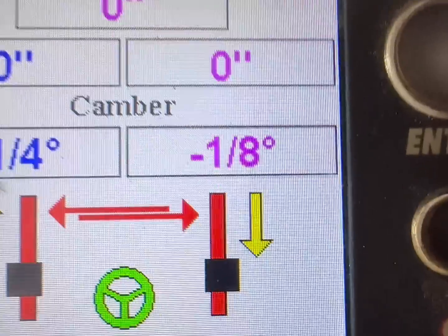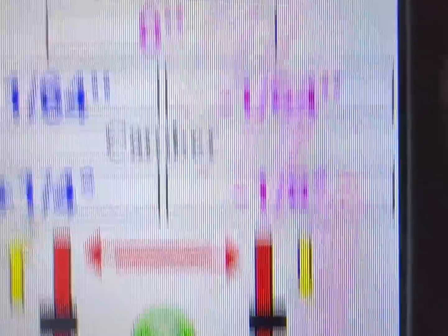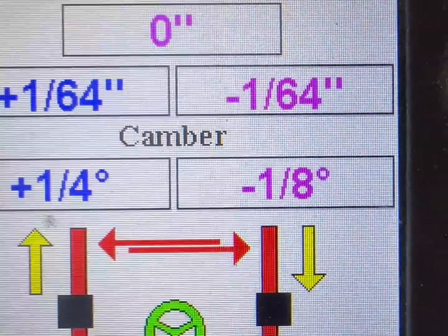This is one of the only ways to actually adjust camber on a semi. Most of the time people don't normally do that — you usually set the toe, do a little castor work, and let it go. But if you want to get maximum life out of your tires, you really have to adjust the camber. A lot of axle manufacturers do suggest that you have this done within the first 50,000 miles — this is the ideal dimension. Hope you enjoyed it. Thank you for watching — me and my pointer are out. Don't forget to smash the subscribe button.